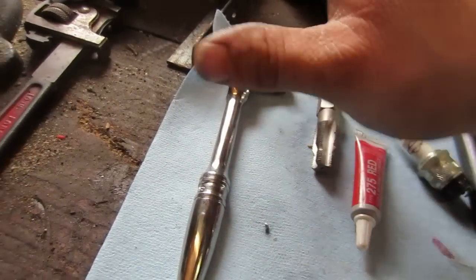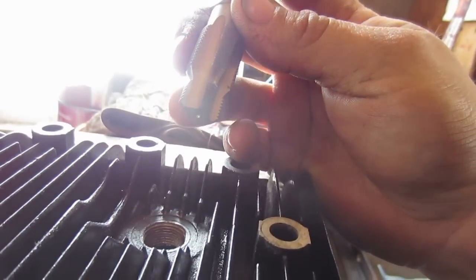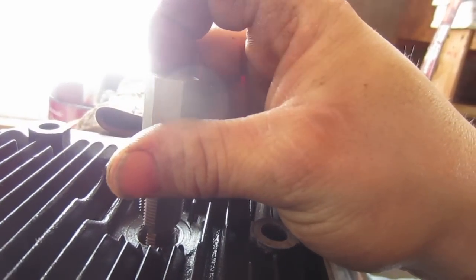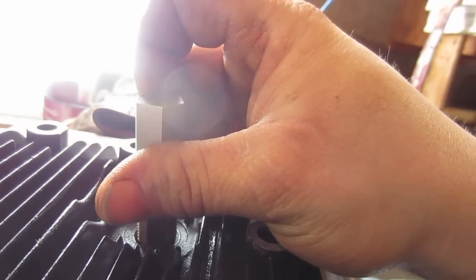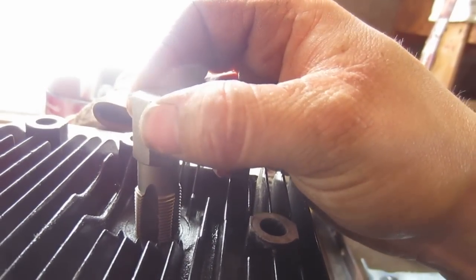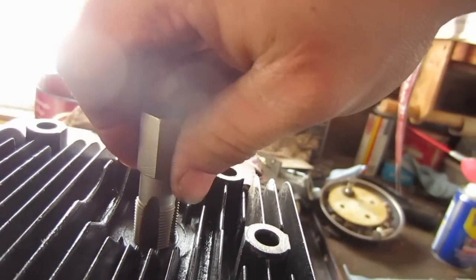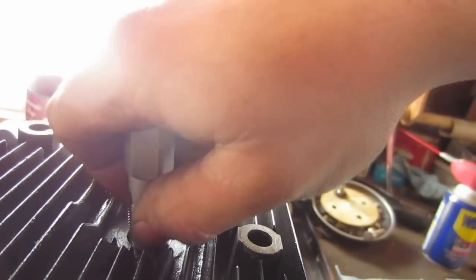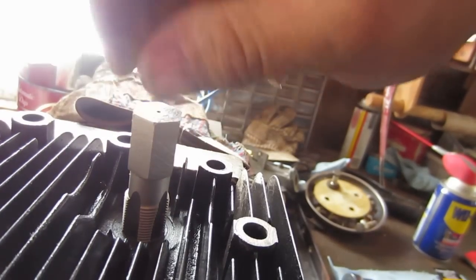It also comes with a two-step tap. You'll have to get a wrench — this is not a standard top on the tap. I've already gone through and did it on the head, because you've got to be very careful to make sure you get that in there square. The first part of the tap will screw into your hole using the old threads if you have enough left — it'll bite. Once you get down to the second part, make sure you get that nice and square, then you can start tapping. I would recommend using a wrench to start with, because I almost went crooked the first time.